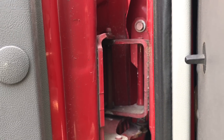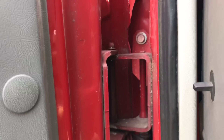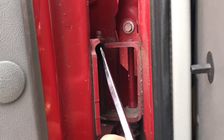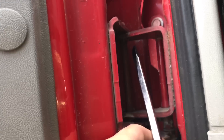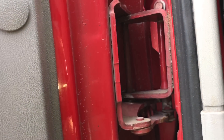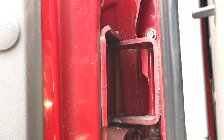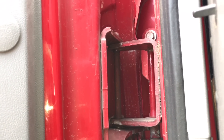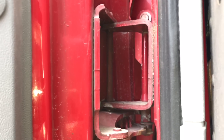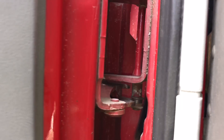Just to show you what we've got going on here — this is the upper door hinge on a 1994 Chevrolet Blazer. You have a bushing here, a bushing here, and a bushing here. Go ahead and lift up on the door, Jake. There's a lot of slop in there because there's a bronze bushing that's worn out. You'll also notice this roller here is in pretty bad shape, so we're gonna replace that too.